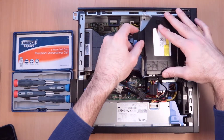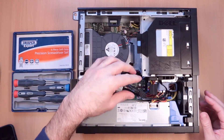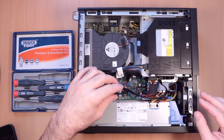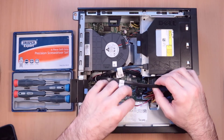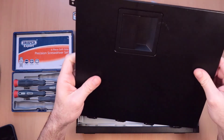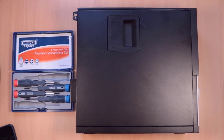Get the CD drive. Get the SATA cable — the power is down here. Put that back in. Grab the lid. Plug it in and turn it back on. And that is all there is to it really. The machine will be so much faster after the SSD upgrade. It's definitely worth doing.